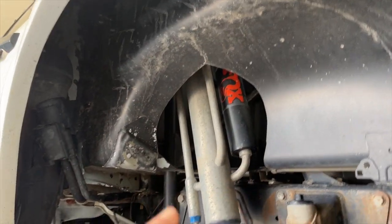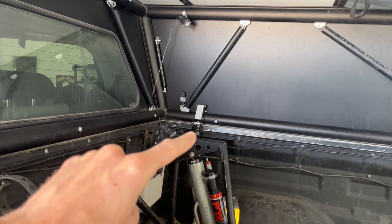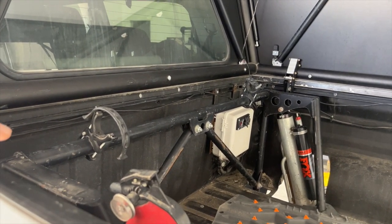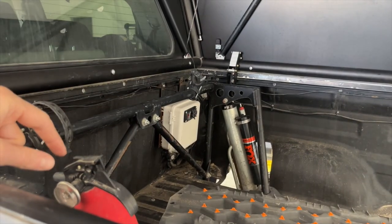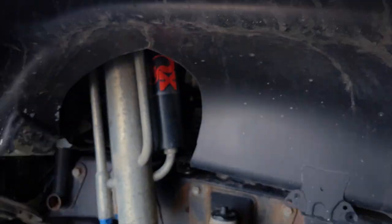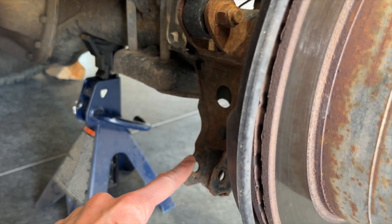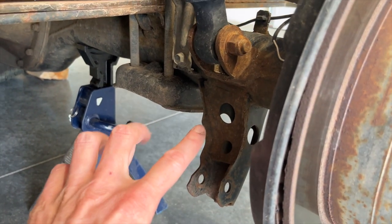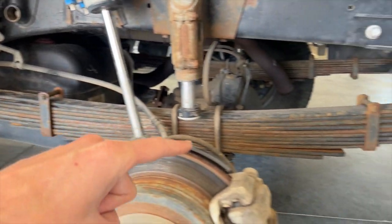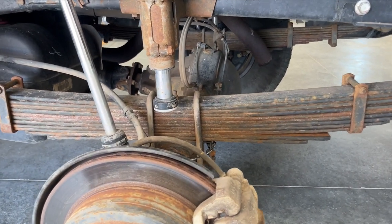You can see there are holes cut into the bed and the shock goes up through the bed. The top of the shock is almost level with the top of the bedside. This is a modular bed cage made to fit back here — it bolts onto the frame, so no real fabrication other than cutting holes. It's very sturdy and braces the shocks on both sides. Coming down, they mount onto your axle at new mounting points, which have to be welded on. If you're going to run a 16-inch throw on this shock, you actually shouldn't be running an over-sprung leaf pack — you'd want to run a leaf pack that goes under your axle, which I'll be switching to when I clean all this up.